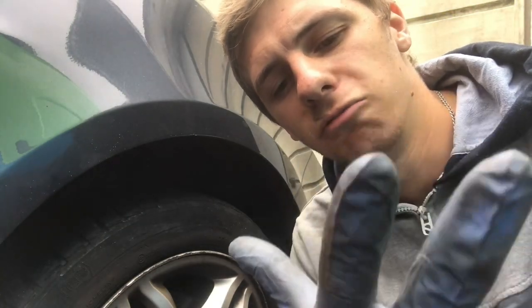Make sure there are no brake leaks, make sure your brakes are working okay and the material thickness is good. Make sure all your lights are working, seat belts are in good condition — they all work and the clips are okay. Make sure your fluids are at the right levels and there are no oil leaks — that'll get an advisory. Check your windscreen and wipers — they're clearing properly. Any ABS faults or airbag warning lights will cause a fail. I'm not sure if a red energy management light would fail it — I've never personally put one through with that light on.